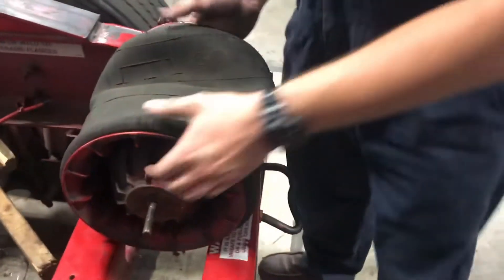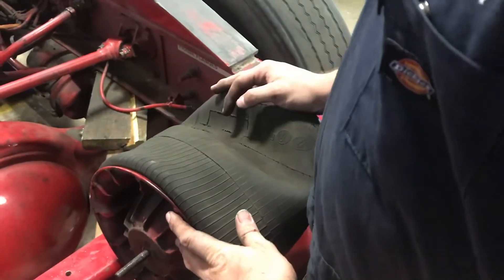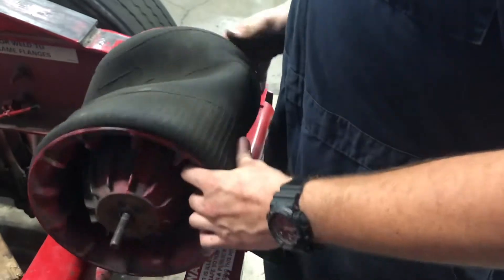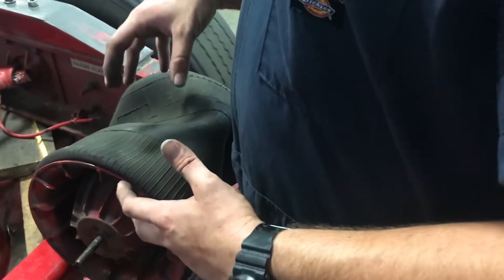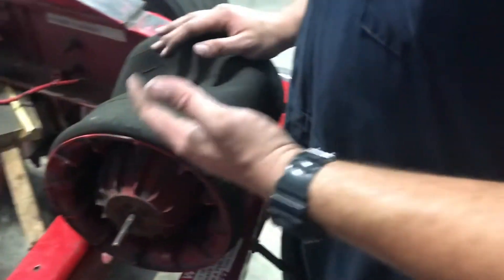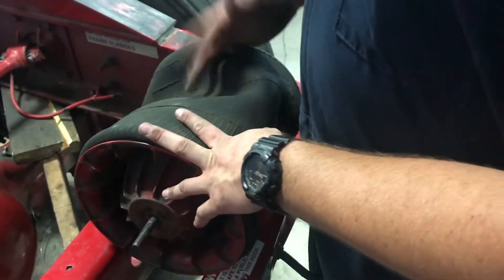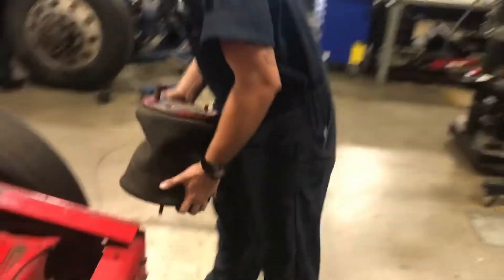There's our airbag. Essentially why do we ever change these out? Well, just like a tire, it's rubber — it can puncture or develop a hole. How I would test for a hole, either on the truck or wherever I can get air to it, is inflate the bag. The best method is soapy water, because when air escapes it's going to bubble up right where the leak is. You can use just water — I've used brake cleaner before just to find a leak in a tire — it'll still bubble, it's just way more apparent and easier to find with soapy water.